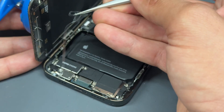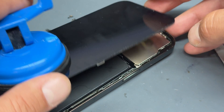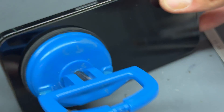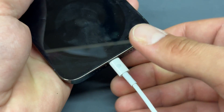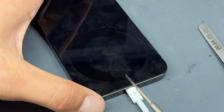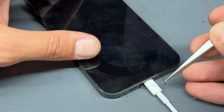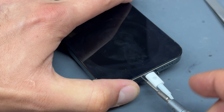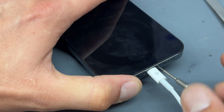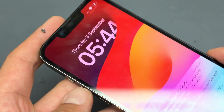None of this repair is rocket science but it does require concentration — make sure you keep your screws organized and you should be all right. There's just one final layer of adhesive to remove: go around it, fold the screen down, and pull it around from the back. Do the same at the bottom — don't forget to do this because it won't seal correctly. I've got a little bend on one of the ground pins so bend that back, fold the screen down, and reattach it at the top. Don't forget the SIM tray. Turn the phone on by connecting it to the charging port — we can see it's now charging. This device was actually in for a microphone issue, but because the microphones are attached to the charging port it requires full flex cable replacement. Get your two pentalobe screws back in the bottom, carry out full testing, and that is repair complete.